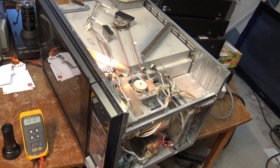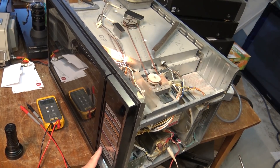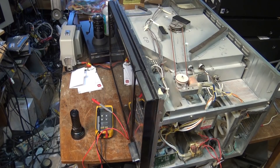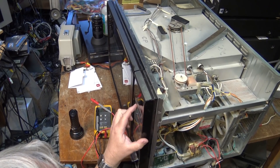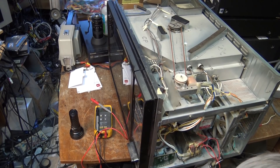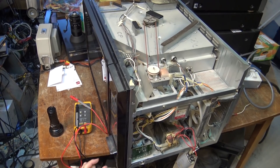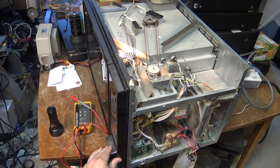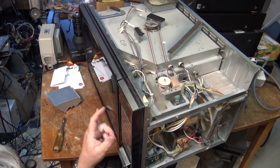I'm wondering where that spark came from. I think it actually came out of the magnetron itself — we just saw the reflection behind the transformer. But I think that spark was the magnetron. That magnetron is no good. This is the unknown one I had just kicking around. I'm checking everything to see whether there's any indication of arcing, but I do have high voltage. We've got lots of high voltage from the transformer. Let's see if the transformer is going to work. Power on — transformer's working fine. We'll try a different capacitor on this unit.